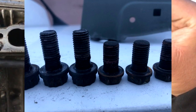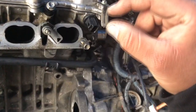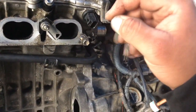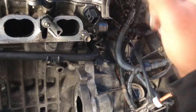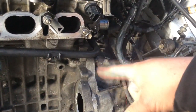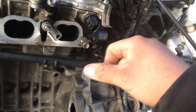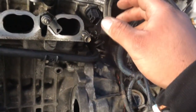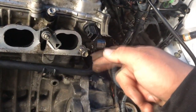And then at the very end where the head is at, it doesn't have threads. So it's able to have a space in between for the shims — the plates that go in between the flex plate. And the manual bolts didn't have it. So when I put the manual bolts in, the crank wouldn't turn.